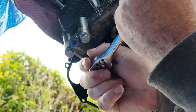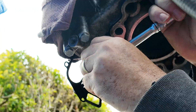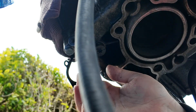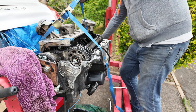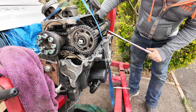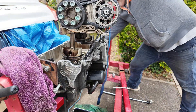I've got to start by taking the crank carrier out in order to put the new cylinder half back on. We're going to take the pistons off and build it in a specific way according to Porsche, because you've got to build some of this through the side of the engine and put the pistons in after the rods are on. I'm going to get the carrier out with my crane and put it onto my homemade engine trolley, and from that point we can start to unbolt the con rods.